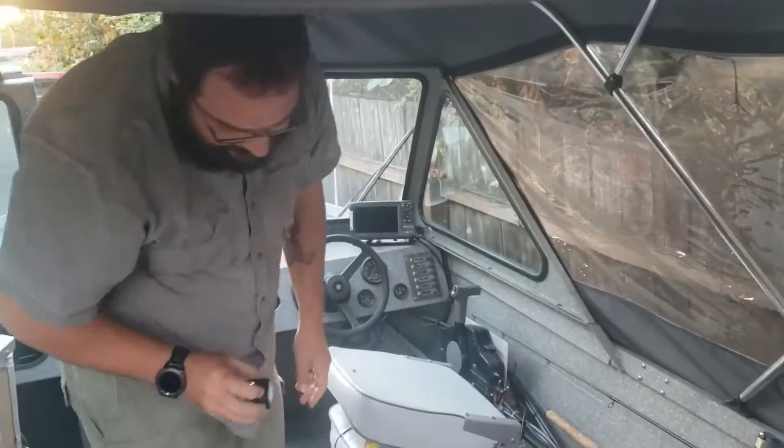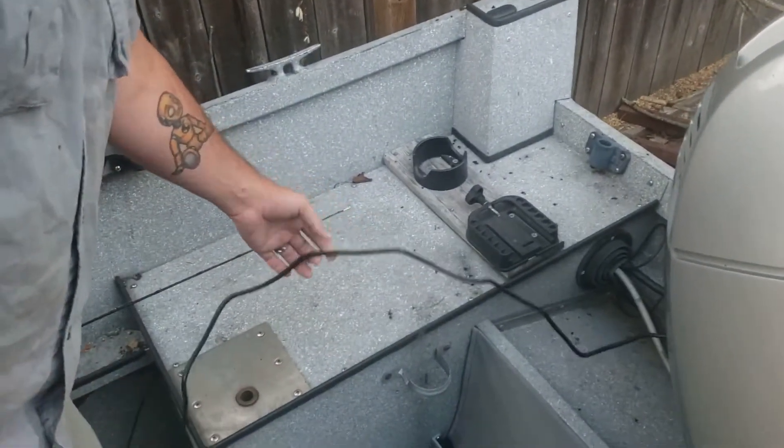We've made enough progress for now. One of the things probably worth mentioning is this — this is our new transducer. I'm going to zip that up for now. When we redo all the wiring, we're also going to put in a secondary battery. It's currently a single battery system, so we'll put a secondary battery in with an ACR. We're going to add some lights. We're going to wire everything properly, do the wire runs with heavier gauge wire for the main power up front, and run the transducer wire through the actual wire galleries. That sounds like a lot more work and a lot less fishing than I signed up for. Well, for buying a boat at half price, I'm not going to complain.